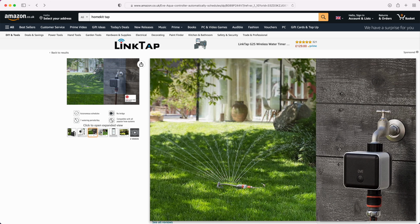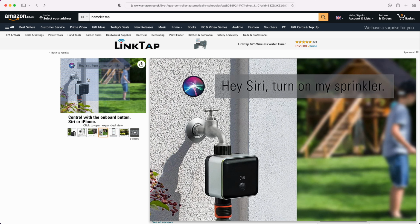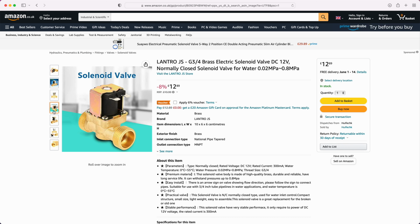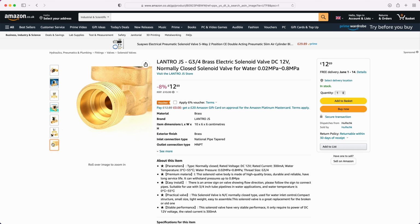Now, there are smart taps that people use for sprinklers and things like that, but they're quite expensive. And like I said, in the original version of this, I was actually having a setup where I switched between normal water and de-ionized water, which meant I needed 2 valves, and I just didn't want to spend that kind of money on this. So I looked at a cheaper alternative, and you can get these solenoid valves. Again, I'll link to these in the description. And they basically open when you give them 12 volts, and they shut when there's no power. So it's actually pretty straightforward to hook these up to Siri.